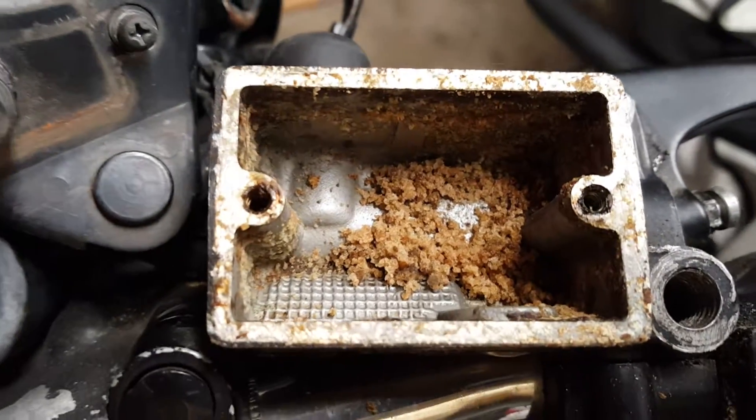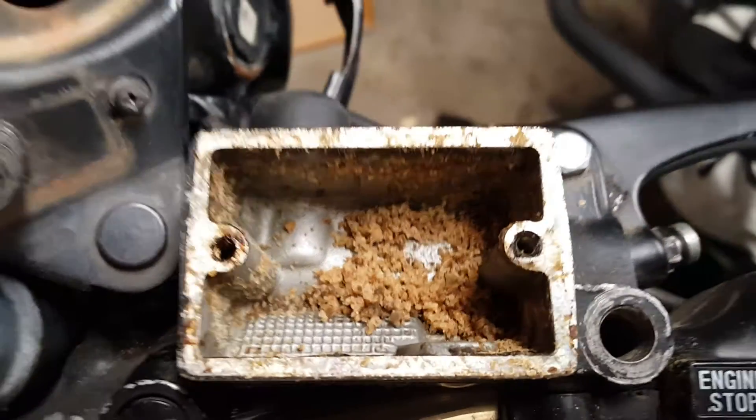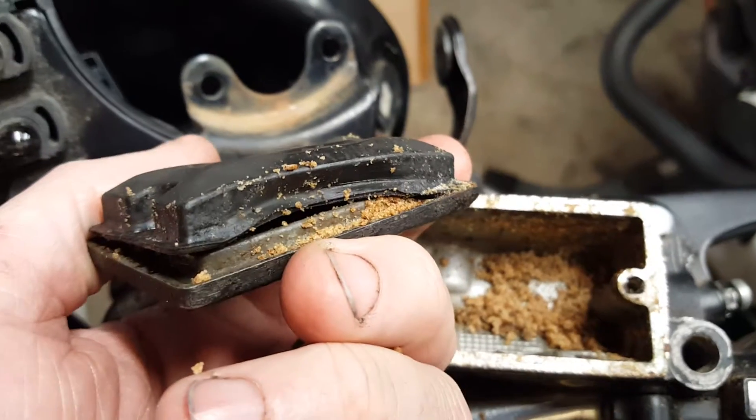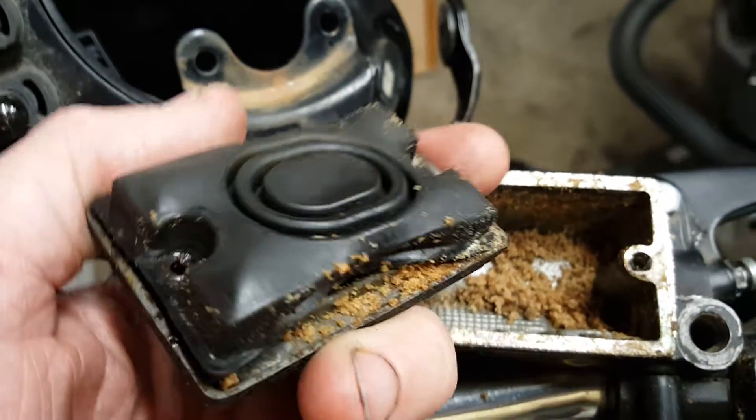Completely crystallized brake cylinder. All the fluid in there is just a mess. I've got the diaphragm here — looks like the diaphragm is torn. I'm gonna have to clean that up, probably have to replace that in some way.